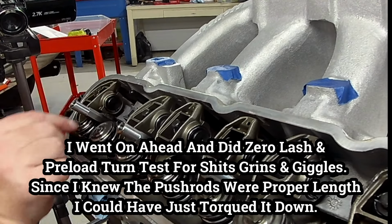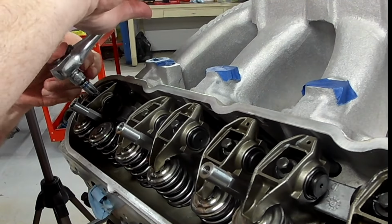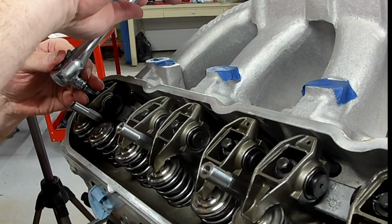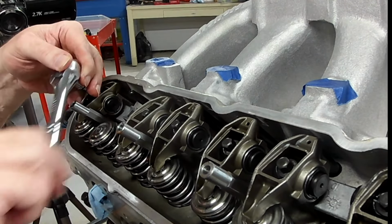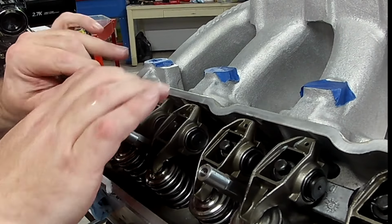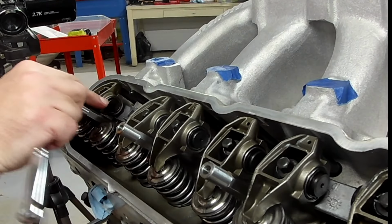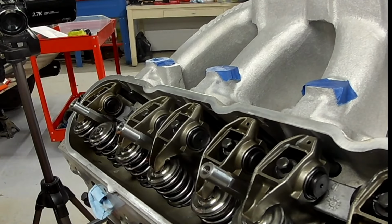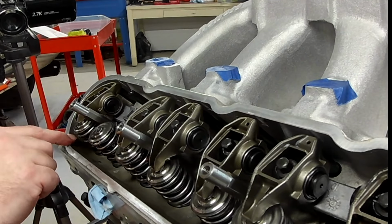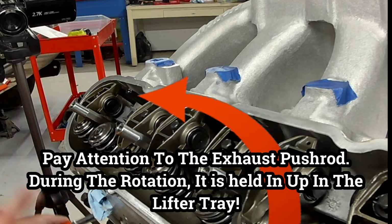Now, once you get the intake set, since you're already on the exhaust stroke, the great thing about it is, once you finish the cycle and you allow the exhaust valve to fully open and then come up and close, it's time for your intake valve to start traveling anyway. So if you set your intake first by using the exhaust movement, and then you set the exhaust by using the intake's movement, as soon as you finish them, you're on to the next cylinder. So it's really easy.